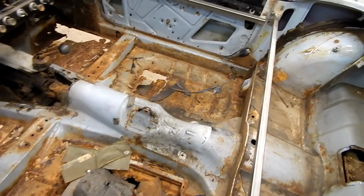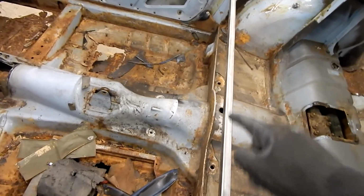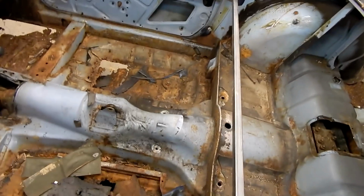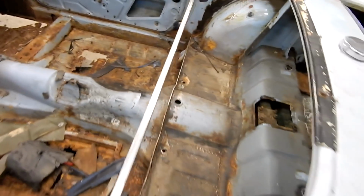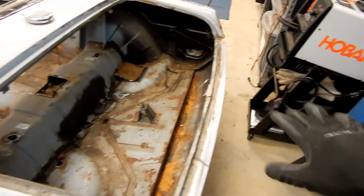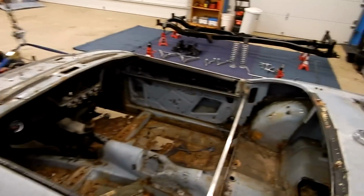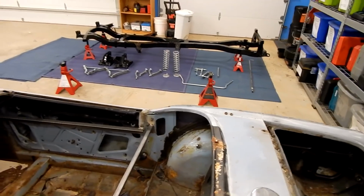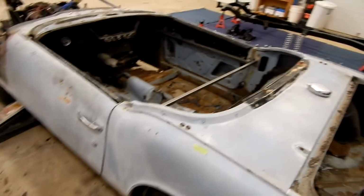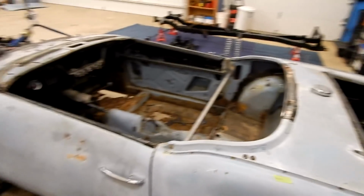I was having trouble with the body not wanting to lift. I ended up taking off the seatbelt retainers, which is good that they just screwed out. Those must have bolted into the frame, which I can't find corresponding holes on that frame over there, but this might be a difference between the Mark II and the Mark III. Anyway, everything's good back here. It's light enough back here. I'm going to lift back here. We're going to use the shop crane on this end. And then what we're going to do is temporarily put it in the middle on those jack stands. Then we'll roll the chassis away, and then we'll transition the body over to here after we clean up all the rust that's fallen off of the body. And then that's probably about it for today.